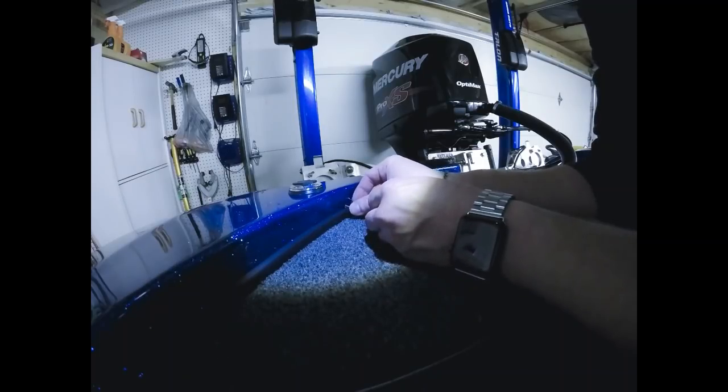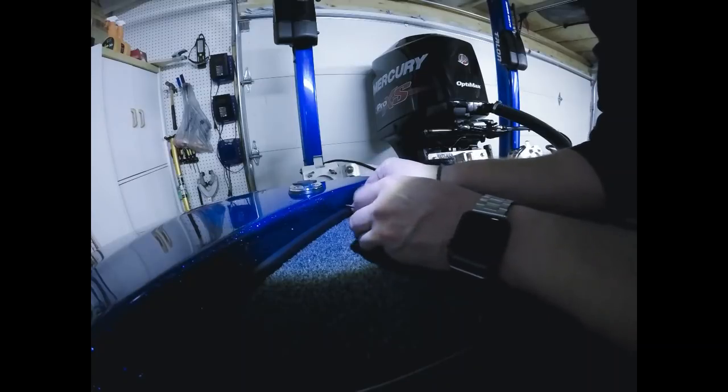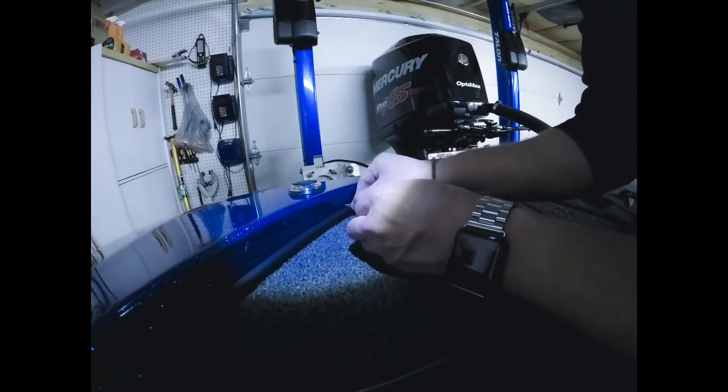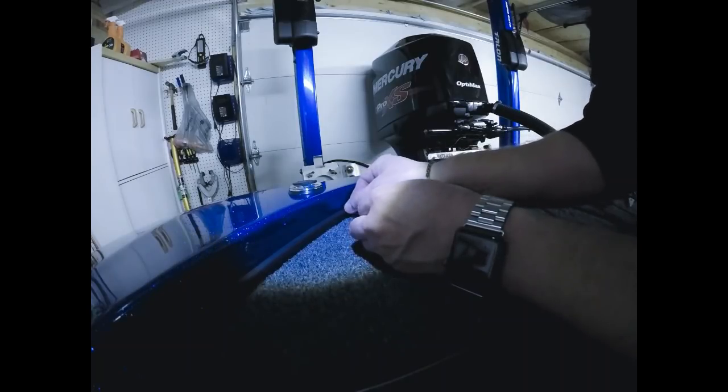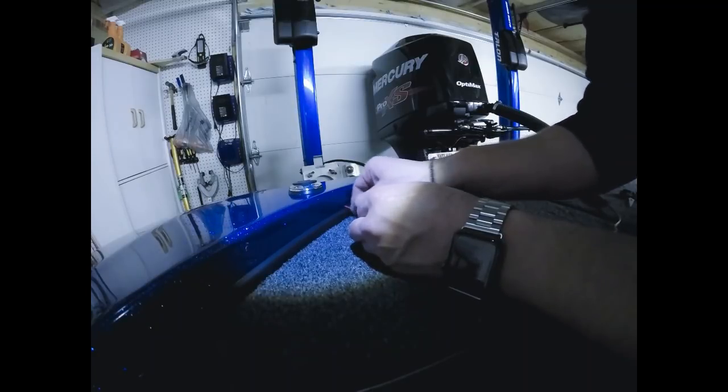So again, for this part, all we're going to do is take both of our wires, and this is for every light. I'll do this part on video. You just feed them through. And again, that 1/8 size drill bit, perfect size. As you can see, they go through relatively easily, but there's not a whole lot of extra room there. Again, it's the perfect size for this 18 gauge wire. So you just want to work that through there.